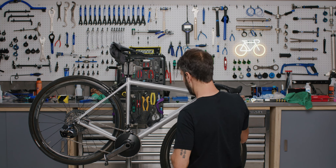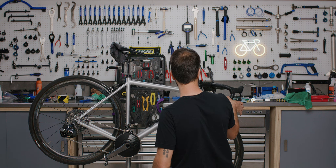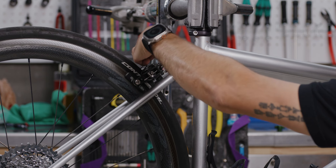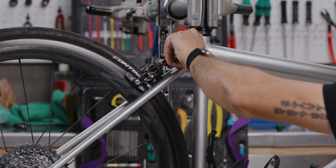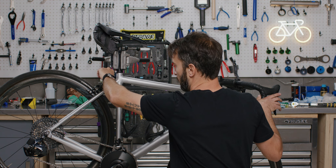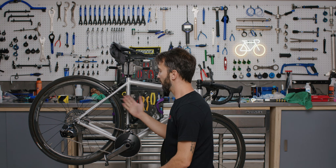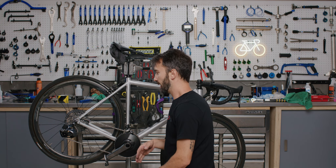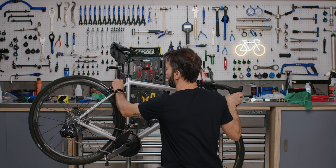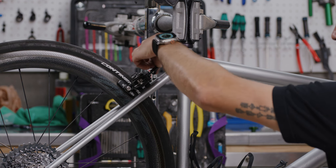The final thing you can do is tune the brake lever feel. Some people like a very short pull so it grabs really easily, and some people like to pull a lot before the brake pad engages. All you need to do is loosen or tighten your cable tension. Tightening gives a shorter throw on the brake lever; loosening gives a longer throw. One thing to note: if you go too tight, when you're really cranking or sprinting there's going to be some flex in the frame and wheel, and that wheel will move back and forth — you could end up with your wheel rubbing into your brake pads. So don't go too tight; just set it where you'd like it to feel at the lever without causing flex into your wheel.